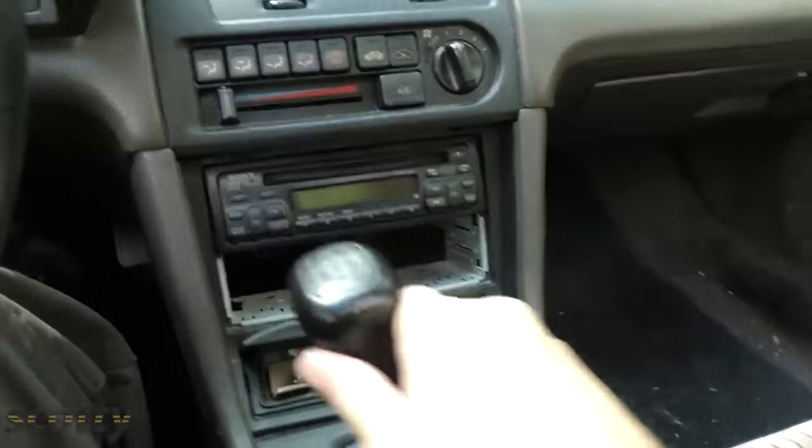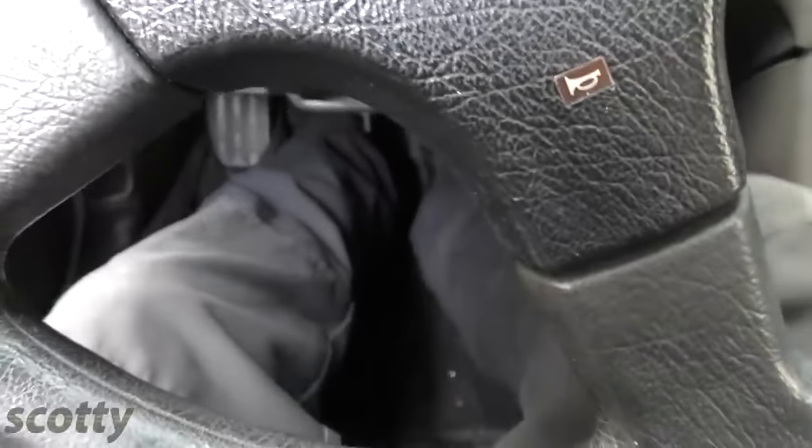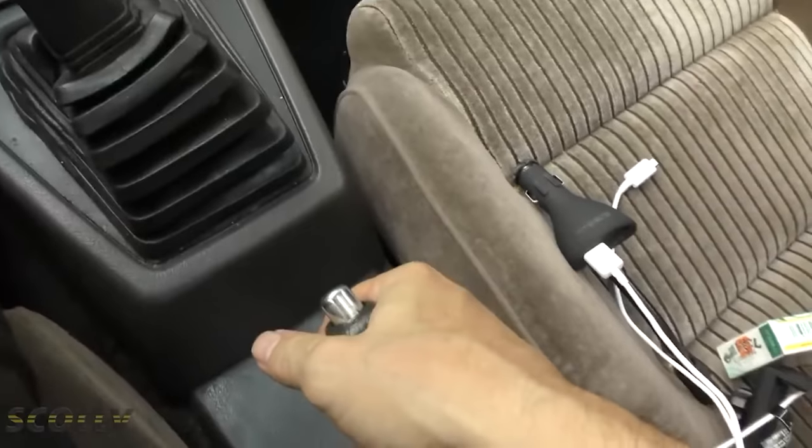If you're parking on a hill, don't just shut the car off, put it in gear, and walk away. I see more cars roll down hills because they either came out of gear or the engine wasn't strong enough to hold it and it slowly rolled backward. What you want to do is have one foot on the clutch pushed down, one on the brake, then put it in gear and pull the emergency brake on. Then when you shut the car off, it's not going to roll anywhere.